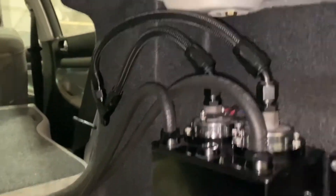The car was kind of built with the intentions of running a huge turbo the whole time. If you watch my fuel system video, I have two 350 liter per hour pumps in a surge tank back there. The turbo I ended up finding is going to make less power than I had originally planned, but it's a good turbo. The kid I'm buying it from has receipts that it was just rebuilt by Precision, and he never reinstalled it — so I'm getting a brand new turbo for pretty much half of what I'd pay for a brand new one.